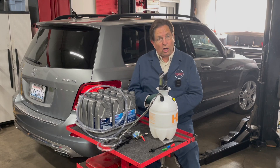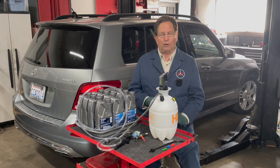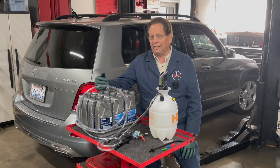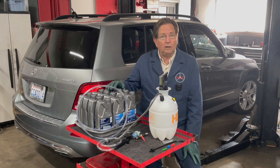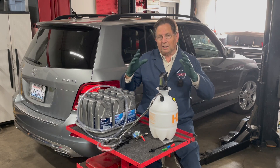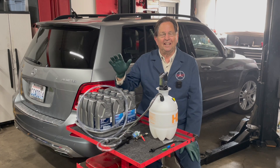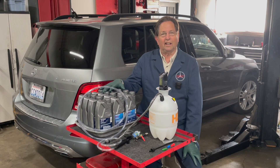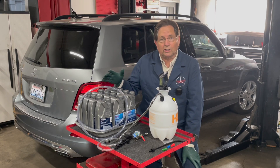So I've chosen to call my procedure a power drain — a full system power drain. To do this you're going to need 10 to 12 liters. You could probably get by with 10 liters if your transmission is really clean, but you might want 12 because you may need to run another batch through if the transmission isn't running clean, or you may misjudge the fill. If you're only doing a drain and fill, most people get six or seven liters — it's going to be your call.